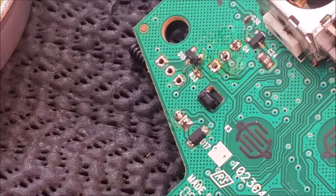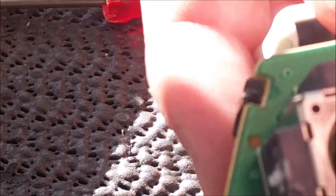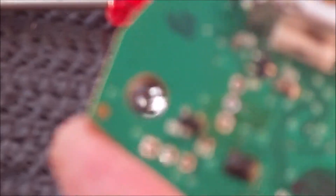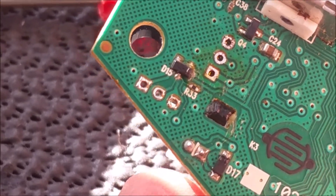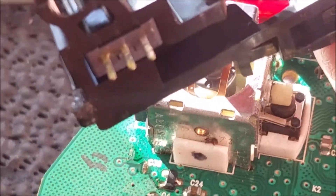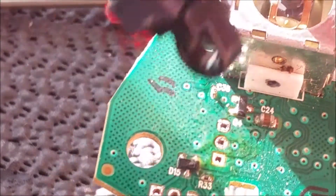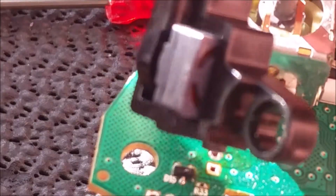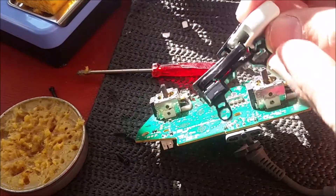You'll see they've been nicely removed. Open that tab with a little screwdriver — these should now wiggle through and that should come loose. So that's what we've removed: these three pins for the switch. Be careful not to break it. Do not try to remove the switch by removing the trigger and everything, because it's pretty hard to get back in — it doesn't really like to be done like that.